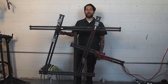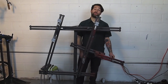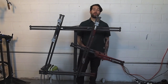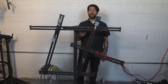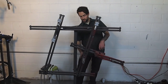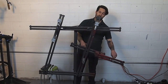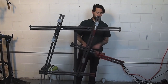Once you've set your front triangle, it's time to set the rear triangle. The rear triangle is where the rear axle goes. Typically you specify that with the bottom bracket drop and the chainstay length. The problem with those measurements is that they're not perpendicular, but it's easy to make them perpendicular with a calculator I've posted to this blog article. What you do is measure along the seat tube and perpendicular to the seat tube — it lands you in the same place, but it uses legs that are square to each other.